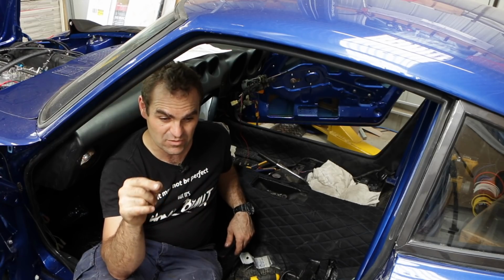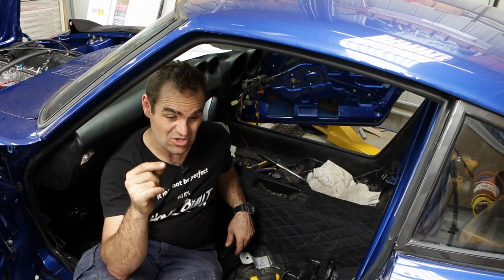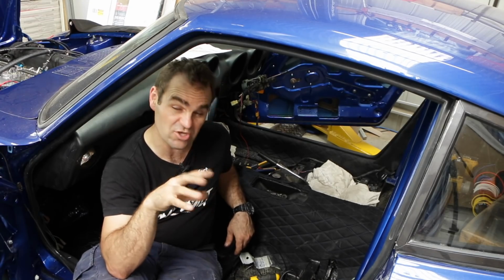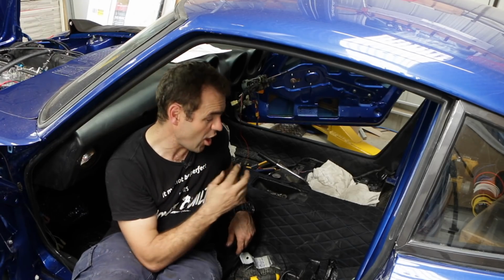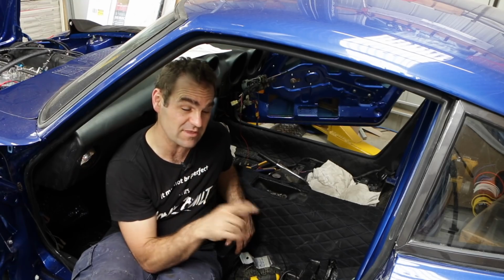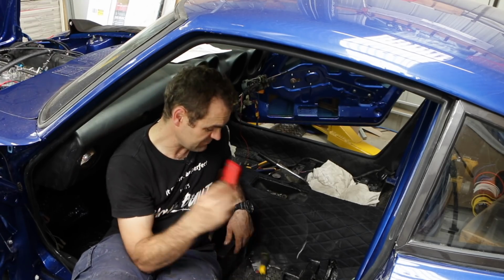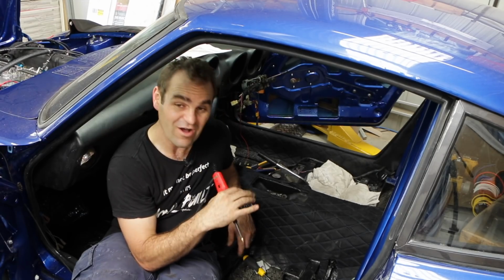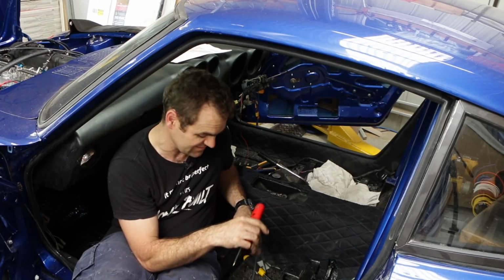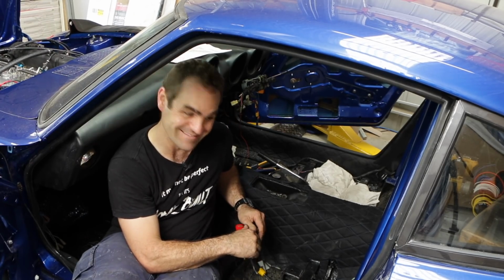And like you saw, one of those lines was already connected to ignition. So there was already power on one side. So now I've rearranged those plugs so that hopefully I should have continuity through to the fuel pump. But I'm going to get this up on the hoist and check that with my power scanner before I do anything else and assume anything, because we all know what assuming does.